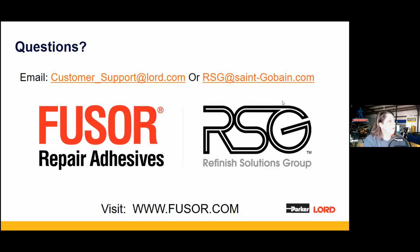Did I escape your question? You did. Yeah. And I get the question a lot of times when techs are telling me more around fillers than seam sealers. They're saying, hey, I always applied my filler direct to metal, never had corrosion problems. Now I'm having them. And I'm like, well, it's different metal. Things are just different. And I don't know if it's more susceptible to corrosion now, or there are changes in the filler that, when you leave that gap, are charging that. But definitely things that we have to think about. I don't do filler direct to metal anymore. I put epoxy down, just so that I don't have those issues.